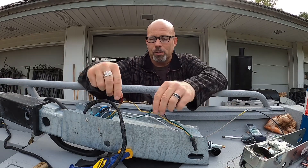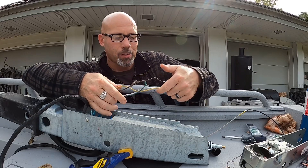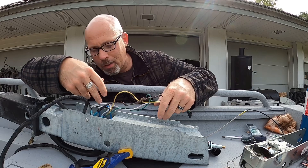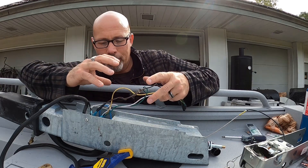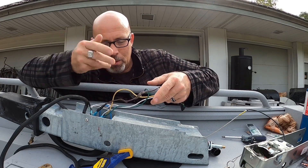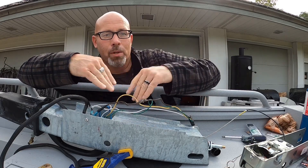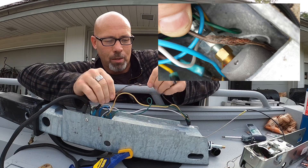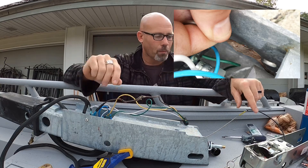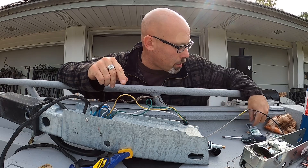Right now I'm going to cut the wire here and replace this little section, then zip tie it nicely so the wires aren't going to float back underneath. There was a piston assembly where the wire actually got shoved underneath, and the weight must have compressed and flattened the wire almost to the point where it was cut in half.